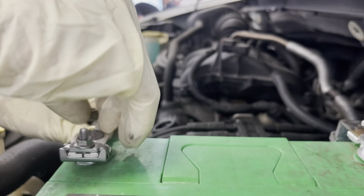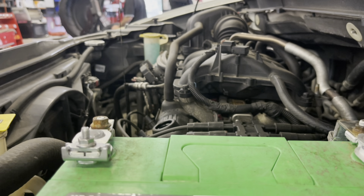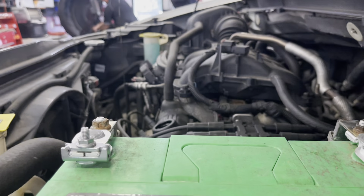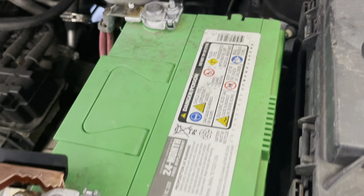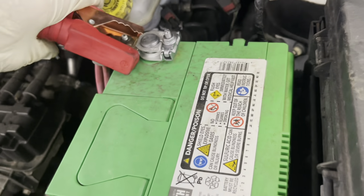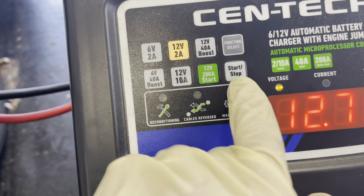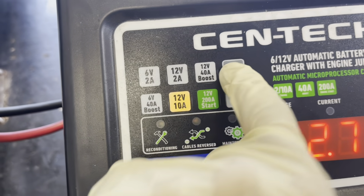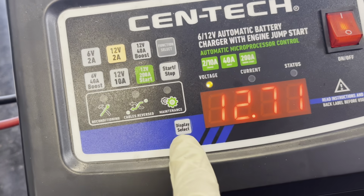Honk. Okay, I'm gonna finish charging this battery while I'm waiting for that drain plug to show up. I mentioned earlier I was gonna re-gasket that plug, but I lied because I don't like that plastic gasket. Because what's gonna happen is somebody's gonna come along and change the oil later, and they will lose that plastic gasket and then put it back in, and it will leak everywhere.